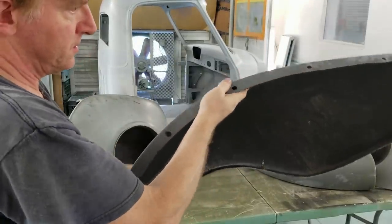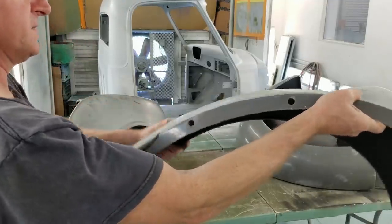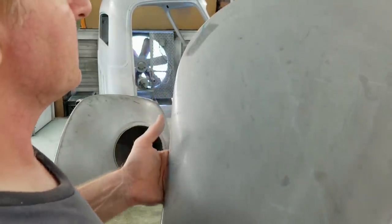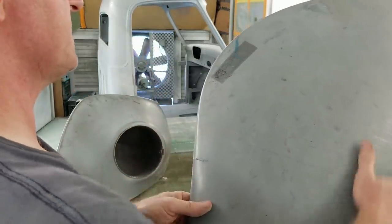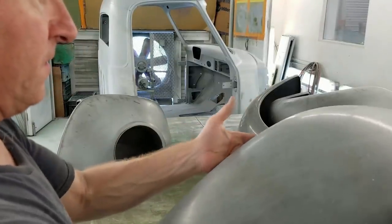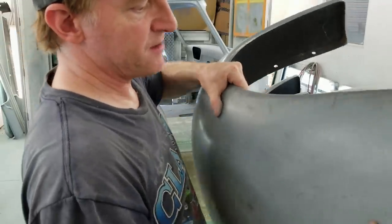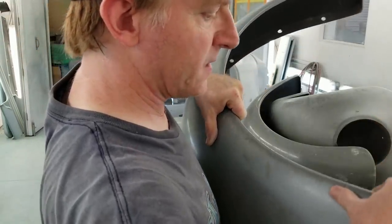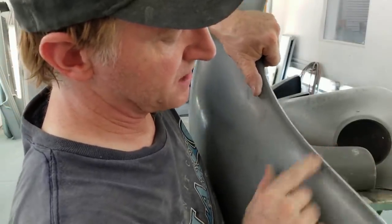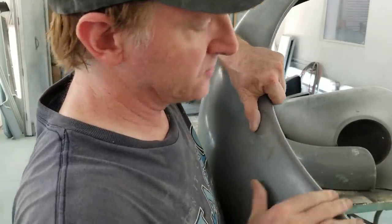Looking pretty good on the seam. Looks good on the seam, so we're okay there. Now we're going to look over the fender itself. Looks like this one is not going to be bad at all. What you're looking for is any types of cracks. There's one right there. That's another nasty one. Anytime you have a break like that, it's going to have to be sliced into, back matted, and then gel coated back up.